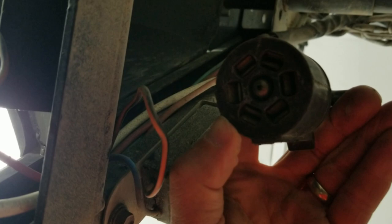So we got the plug here. As I showed you while I was driving, it was working just fine. Now we got this little dingle ball that runs to the battery, unfused, and this is the pull-away break. So if you break free of your ball and your trailer goes off, this thing pulls out and slams on the binders. That's the blue wire going back here, and we also got a blue wire coming from the plug.